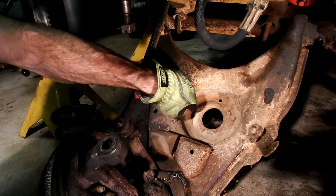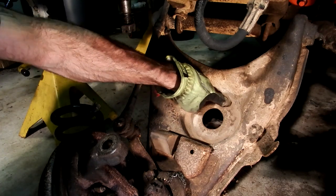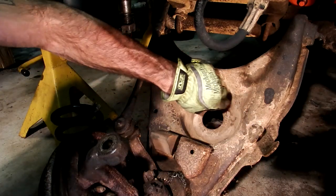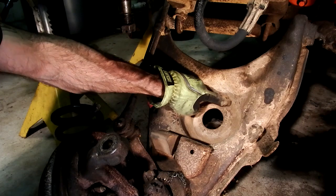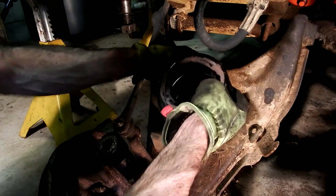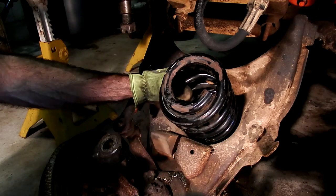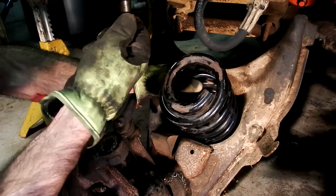So this is probably one of the most important parts of putting your springs in - clocking them. When you see here, this goes down, so this is where your spring end is going to sit - it sits right in here. If you put it somewhere else your car is going to sit angled, it's not going to be level and you'll get a lot of creaking noises. So you definitely want to make sure the spring end is wherever that deep clocking position is. It kind of goes up and then you can feel it drops down right there. We're going to take the end of the spring and get it right in that pocket. And then when you're jacking it up you've got to make sure this is seated correctly up here - there is a little horn section that fits inside here. We'll go ahead and jack it up and put the nut back on the lower ball joint when that's up, torque that down and we should be good. And then we're going to replace this hose as well.